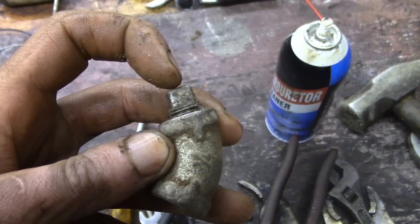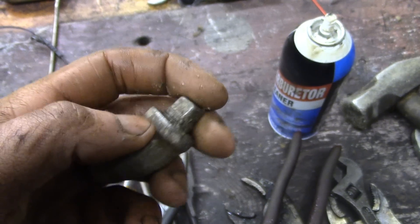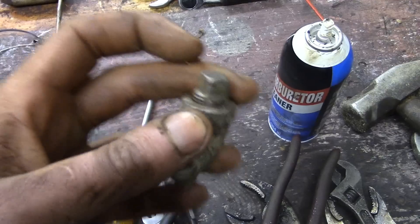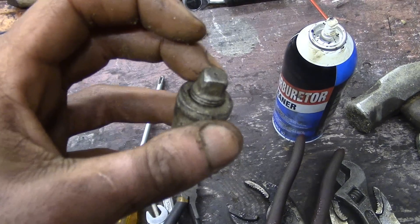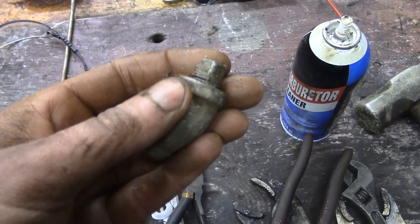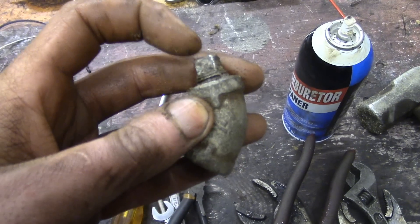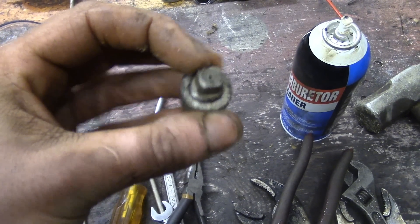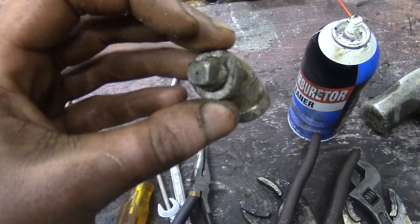The number 56 drill worked really well. I drilled a little bit of the way down from the front side and then from the back side I drilled in with a larger drill bit. My thinking is that it would reduce the resistance to flow — if the water had to flow through that long skinny hole through the entire plug it might reduce the pressure or velocity a little bit. I don't know if it made much of a difference, but that's just what I did.